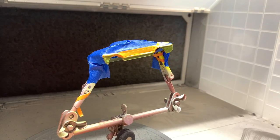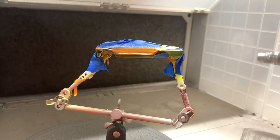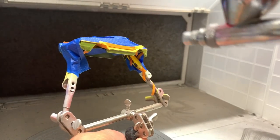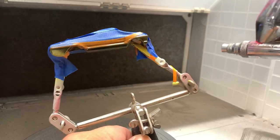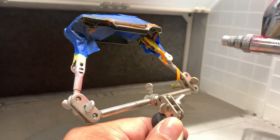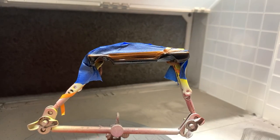We've let the car set for approximately 24 hours. Now we're going to paint the bottom half of the car in opaque black from the Redline Shop. Got it taped off really well. Take your time and put on light coats, because you don't want the paint to saturate and get up underneath the tape. By putting light coats, you're sealing the edge of the tape before applying the rest. Also, the underside is taped up — you don't want paint to spray up into the car through the windows and overspray onto the rest of your paint job. Please be careful with that.